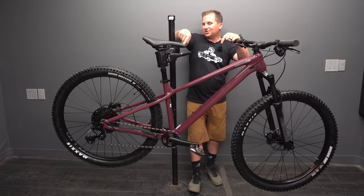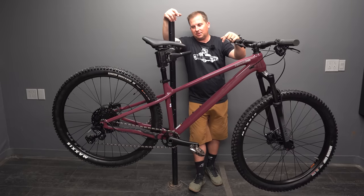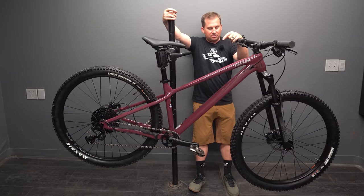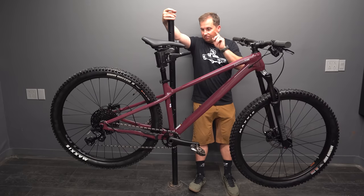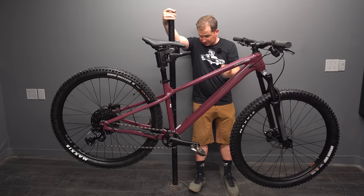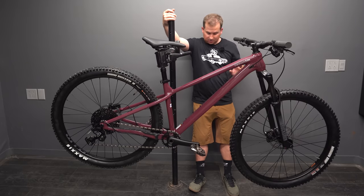These wheels are tubeless ready, but they don't have rim tape. We're seeing that a lot of companies these days are not running rim tape on there. So in order to get them tubeless ready, you're gonna have to pull the tubes, pull the tire, pull the rim protector strip or leave it, and then tape it, then get valves and then sealant to make it tubeless.